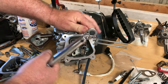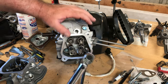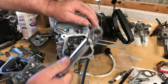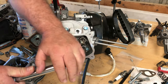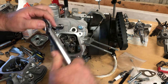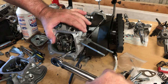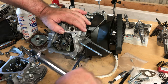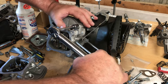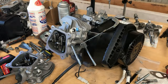The 224 Predator head has a lot better work on the ports — I've not ported these heads, it's just a stock Predator 224 head. I'll go ahead and put the torque wrench on this and torque to 17 foot pounds, which is about 203 to 204 inch pounds. That's why I'm using the little quarter-inch inch-pound torque wrench — these things are handy, they'll do your head bolts, side cover bolts, and connecting rod bolts. With the steel shim head gaskets it's more important that you torque them properly — they're not as forgiving. I went ahead and put new head bolts in there too.